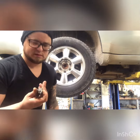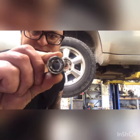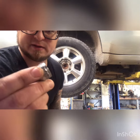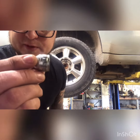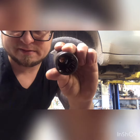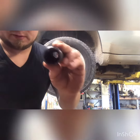What's up guys, today we've got ourselves a locking lug nut and I don't have the key for this one — it's a six-point. I'm gonna show you how to take that off the vehicle. If you look at the edges here, there's little grooves cut in. I put those in with a 12-point socket — regular 12-point socket, impact grade. The grooves were cut in by that 12-point socket.